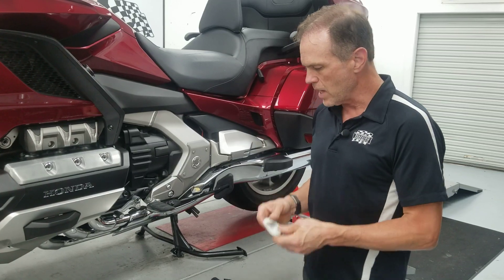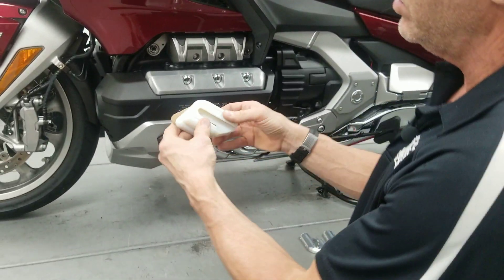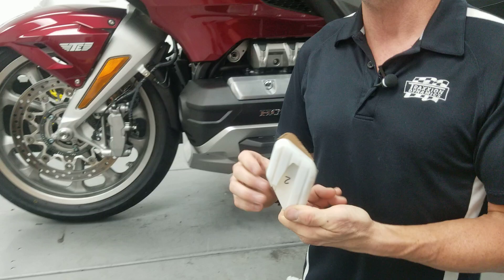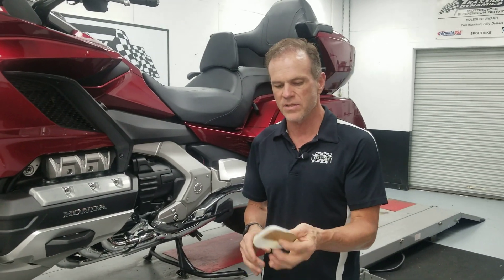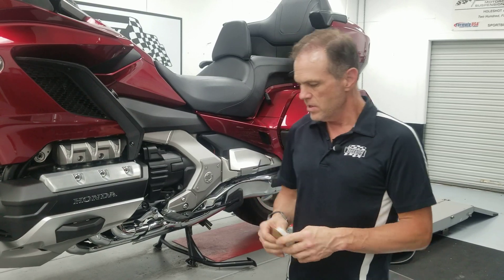What I'll do then is mock the part up with more pieces of cardboard, and you can kind of see some evolutions. We were here, we added this, and I still felt like we needed more. I have a trick where I'll print to scale a two-dimensional view of Adam's model, then take my part created with cardboard and trace over it. I can take a picture of that and send it to Adam, or if it's more complex I'll just put it in a box for him to pick up. He does another CAD rendering, we have another printing done.